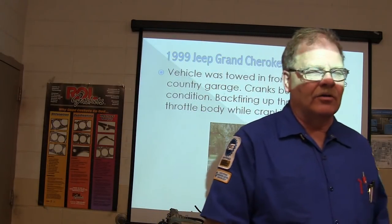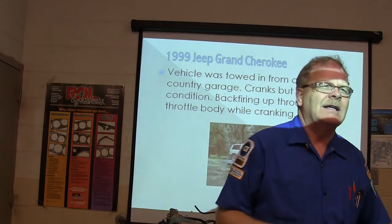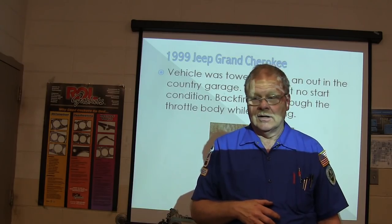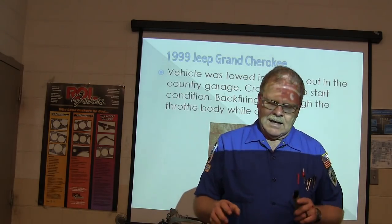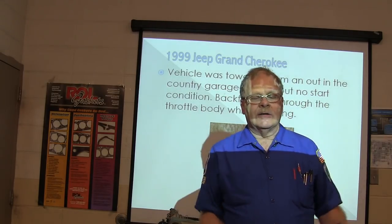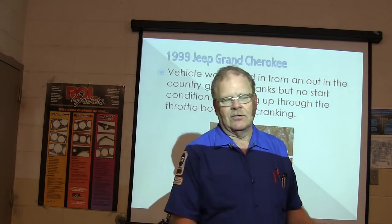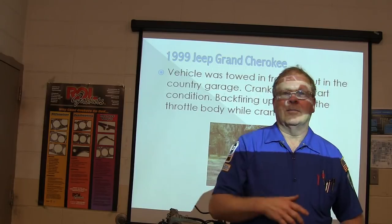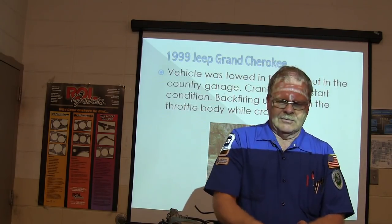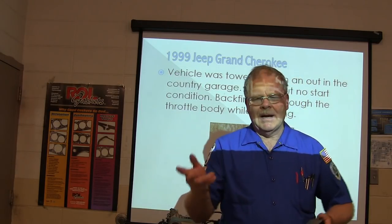You know, if you put your plug wires on, you remember when you were putting the 350 on, whoop, whoop, bap, boom, bam. Back in the day when I worked at that shop in Enterprise 40 years ago, it was 41. I said, I'm going to put the plug wires on his Cadillac. I know how GM is wired up, 1-8-4-3-6-5-7-2. So I popped all those spark plug wires on there, and I spun it over, and it goes, hoo, hoo, boom, fire out the carburetor, booming out the exhaust. I said, I must have crossed the ones going through the motor mount, because they run the wires through stupid ways back then. I'd swap, maybe these two were crossed, and boom, boom, bam, bam.